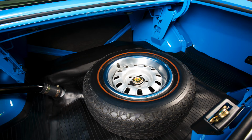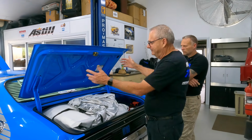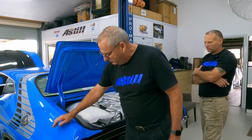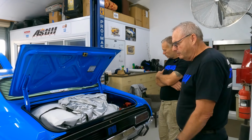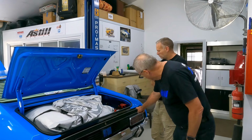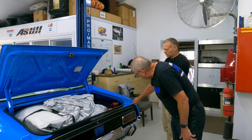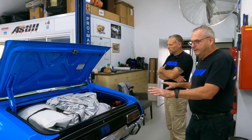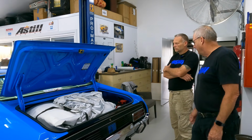So what I like about this car is just how nice it looks in here. All this sort of stuff, the factory stickers. I just get excited about this stuff in here, it's the hard bit. We can all get this to look nice, but in here, and that all comes from Darren's work with the steel, and I was involved in that a bit as well. And then all of that filler, and more so with this sort of car, you'll see on Boss XC where we're doing that, this gets filled up and welded, where this is all factory, and that's actually harder to do than a show car because it's got to be right, and it's got to have the sealer in there and then get painted. And then you really can't go in and polish it, so it's got to come off the gun really good. And all of that is really holding up really good.